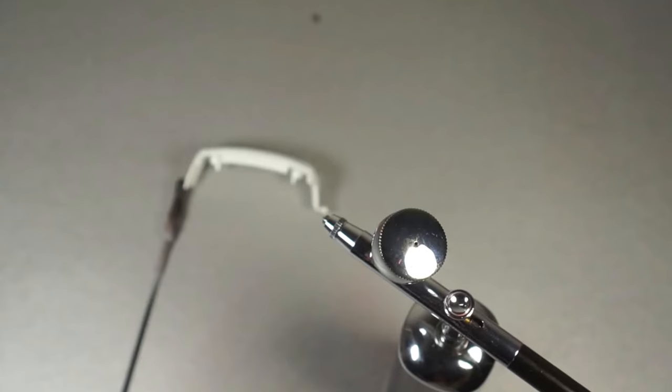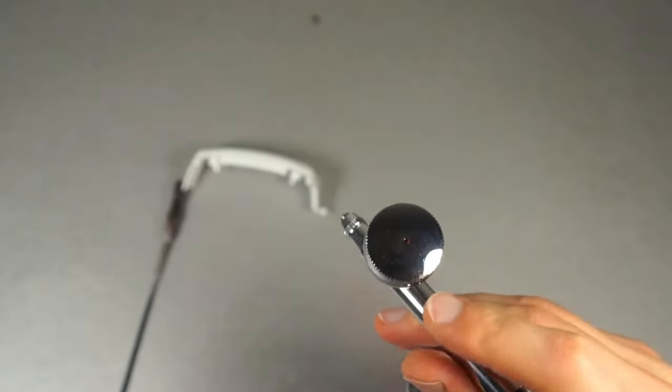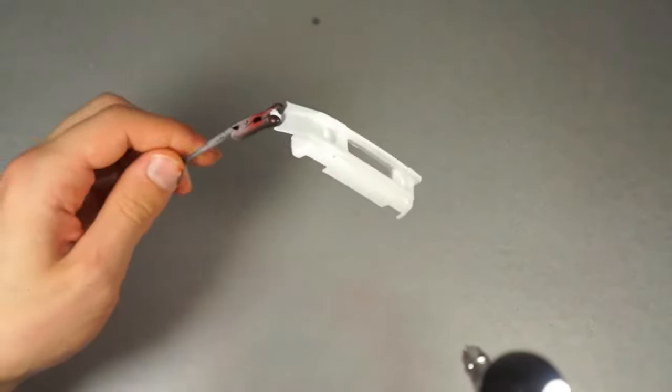If you look closely, you will see that paint dried up a tiny bit too fast. This might be caused by warm air coming out from the compressor. That's why you see dust-like edges and not very smooth transitions. This problem is usually solved by adding more thinner or paint retarder. That's what I did in order to achieve glossy finish on this car bumper.